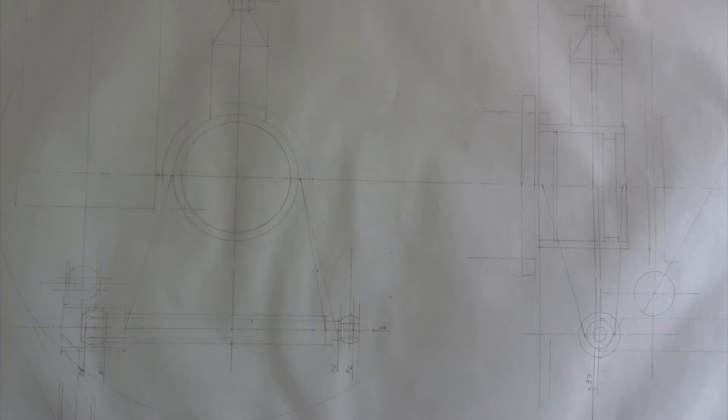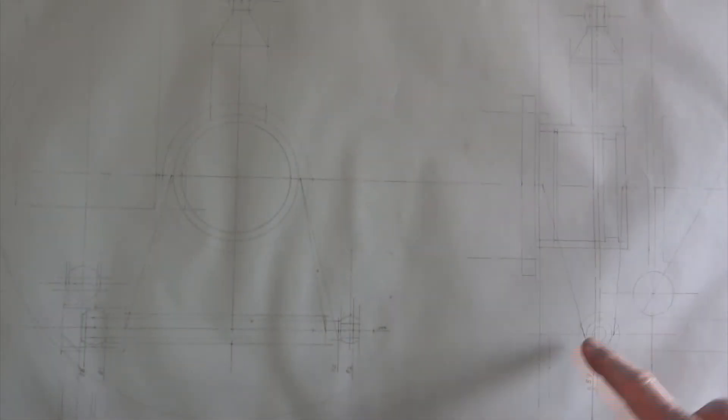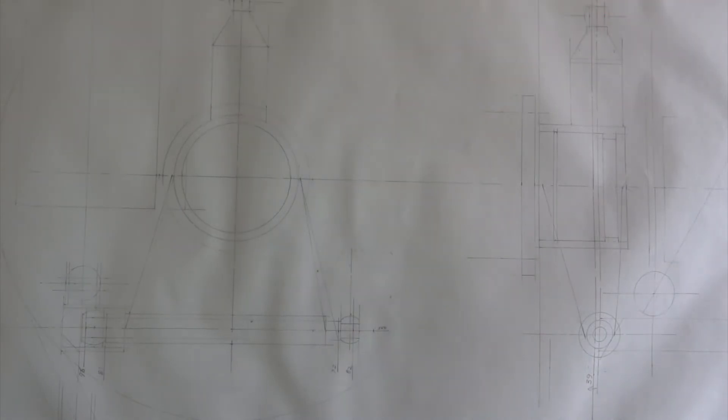Not sure how well you can see that, but that's the drawing that encompasses the driveshaft assembly. There's the wheel flange and the bearing — the top wishbone goes there, bottom wishbone underneath. So that's the toe link, the wishbone with the shock absorber on it goes there, bearing in the middle, and top wishbone above.